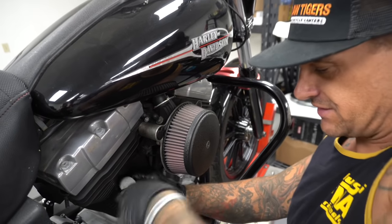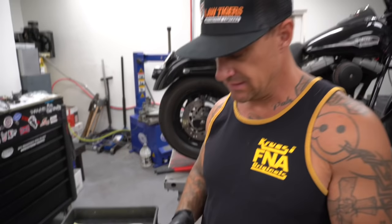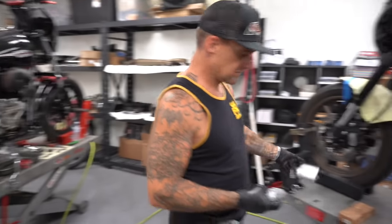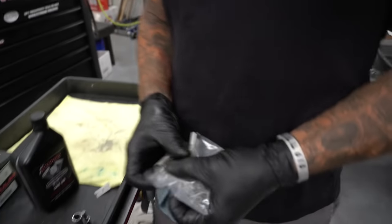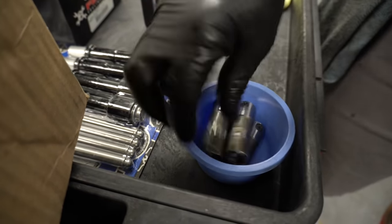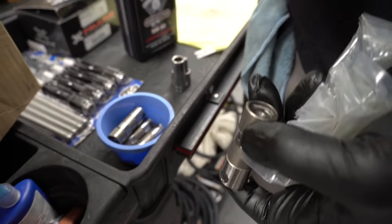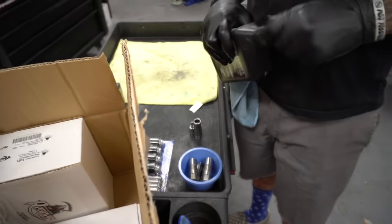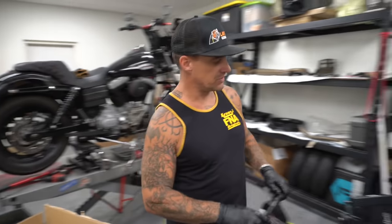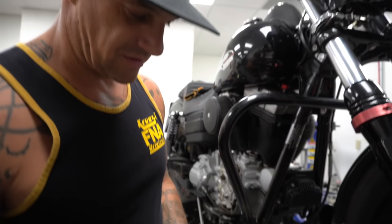I need to soak the lifters. We're going to do something I should have done in the first place — put some oil in a cup. This is kind of the lazy way of doing this, but it works really well if you don't have a syringe. I have a syringe for this but I'm not going to dig it out. They have to be filled with oil — they're hydraulics, so you've got to pre-fill them to get all the air out. You fill them full until fluid pumps out the top, but you can just put them in a cup and fill it full of oil.